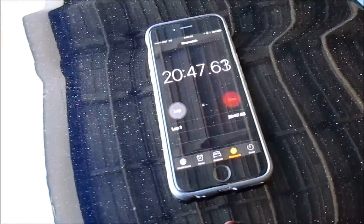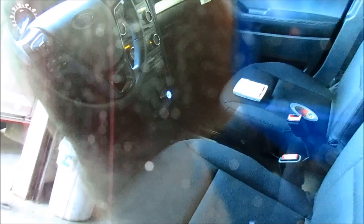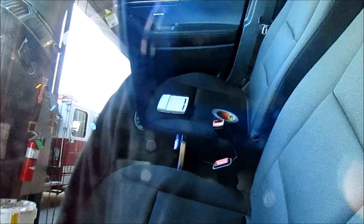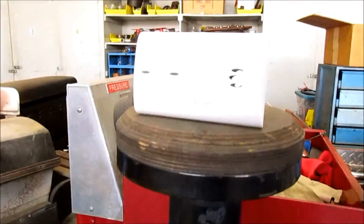We're back and it's been almost 21 minutes now. We're still hovering between zero and one part per million. The blue LED on the cigarette lighter carbon monoxide detector is still blue. The detector on the seat is not going off. The vehicle is still running — it's been running this whole time. The third detector has not gone off either.